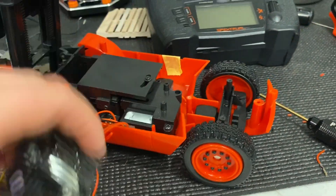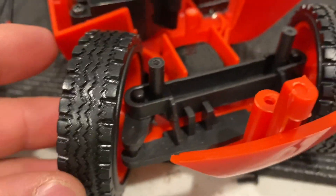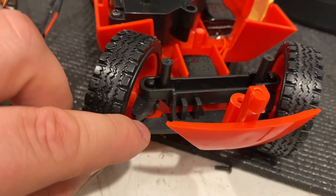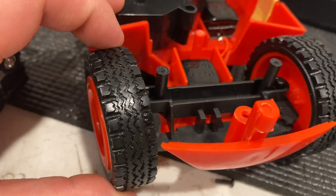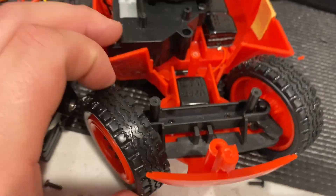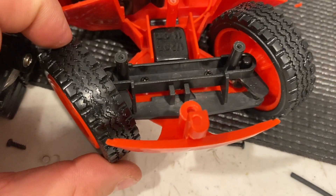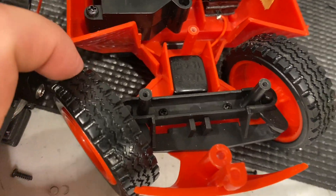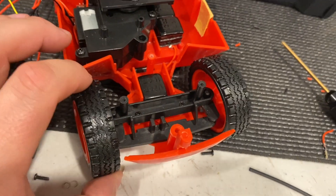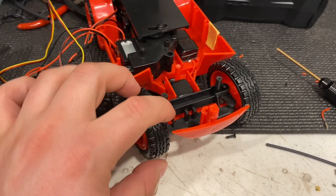The last mod I made for my dad: there's a bit of poor engineering built into this thing. If you see where I ground away at these little tips here — the reason is when you steer, they're a lot wider and they bind. I was able to clean all that up, and look how much more steering I get now in both directions. You can probably take off more, but then you start colliding in other spots — especially up here you start crashing the tire out. So you can only get so much out of it, but this thing turns a heck of a lot better than before. That's a quick, easy steering mod.